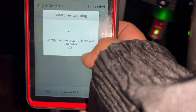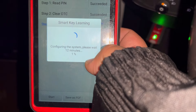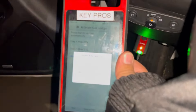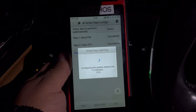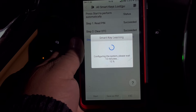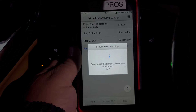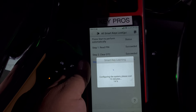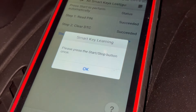Just follow the directions — this should be easy. We wait our 12 minutes and then continue. Our key is in the programming slot. It's at 9% — make sure you have a good internet connection, your USB cable connected to your VCI OBD connector, and your key in the programming slot. The hardest part is reading the password for these vehicles. The rest should be easy. If you see a network failure error, that means your internet is bad or your VCI USB cable is not connected.